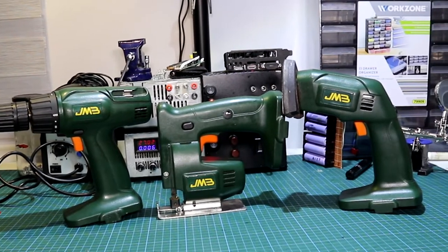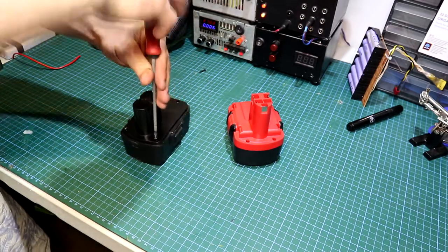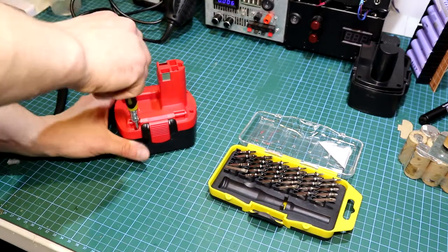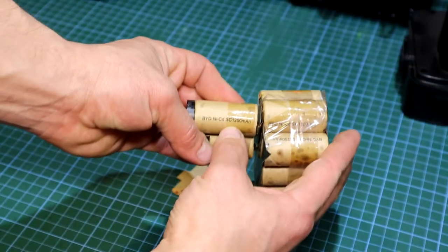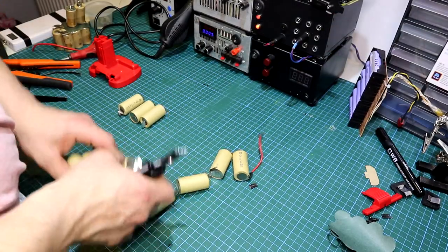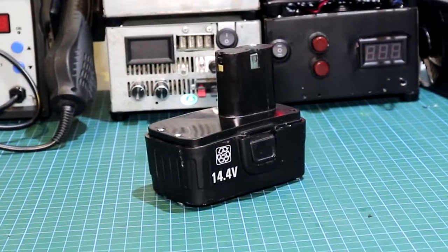With all the tools converted, we move on to the battery and swap the bad cells with good ones. Be very cautious when working with batteries — if you are planning to do this, you will be doing it at your own risk. After removing the screws from the old battery pack and taking out the cells, we can see they look a bit worn out — normal after some years. The new cells look much better, with a capacity of around 2500mAh compared to the old cells at about 1200mAh. The two batteries also look different internally, so I separated the new cells and arranged them into an identical shape to match the old battery pack. After closing everything up, the battery is successfully converted.